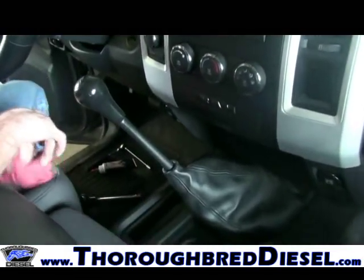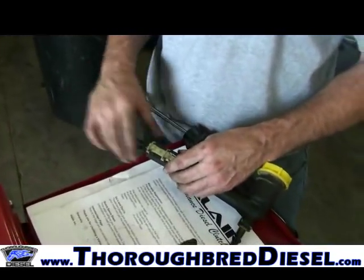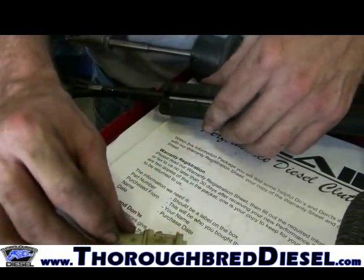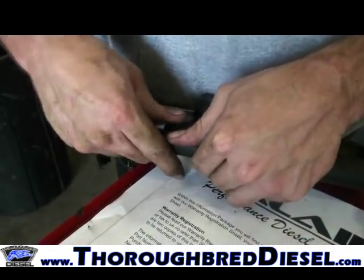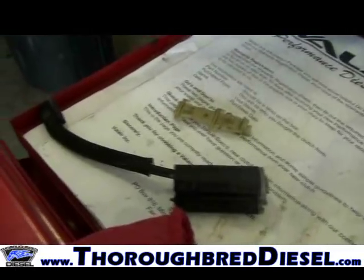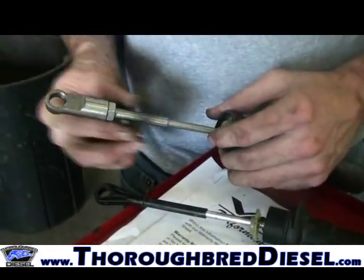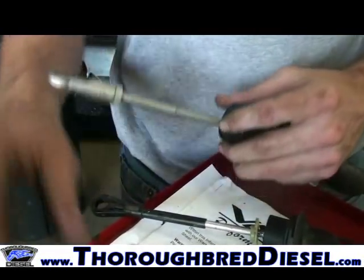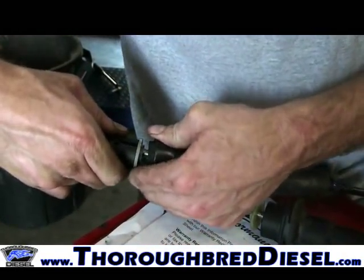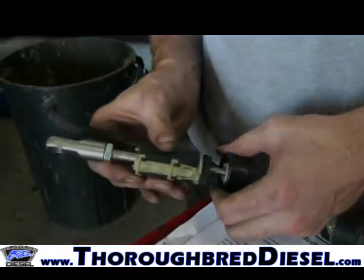Now it's on to the hydraulic assembly. Remove your neutral safety switch from the old master cylinder assembly. To remove it, push the two plastic tabs at the bottom together, slide the keeper up and out, push on the top of the switch, then push from the bottom. The foam grommet transfers to your new assembly, but the plastic one does not. Put the foam grommet back on your new assembly — the spring engages on the shoulder. When putting the new switch on, start it low to make sure the spring assembly engages, then pop everything back into place and replace the cover.